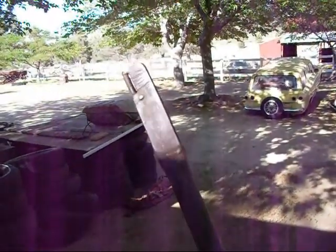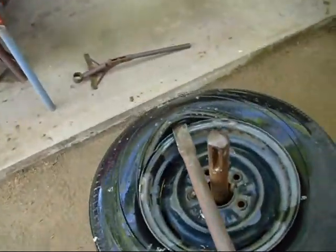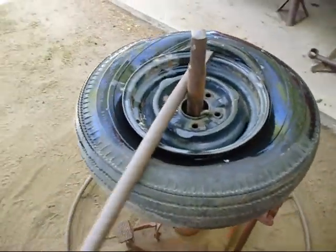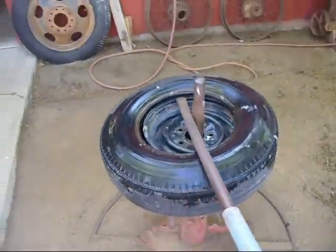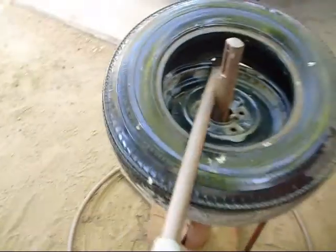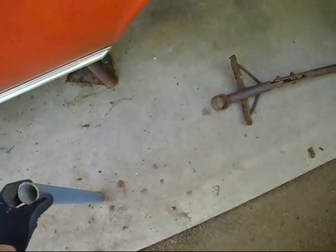The next tool is the bead breaker bar, which you just kind of stick in there like that, flip it over. I like to use this extension pipe because it makes it easier. You get on the back side of it here and the iron tire man just sucks it off. There we go - got half of it. Then you go down in here to get the other half. You got to go fast sometimes. Get that sucker off there. There we go. That's why they call it the iron tire man - because you got to be an iron man to get it off there.